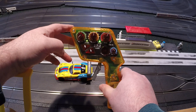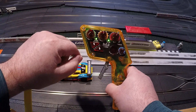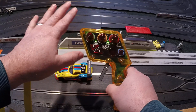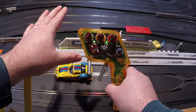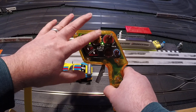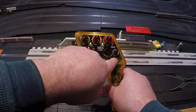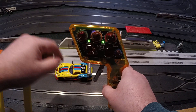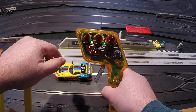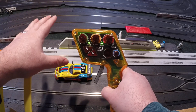You're going to have to experiment with all of these, but rule number one is: only change one knob at a time. Mess around with the min speed knob, don't change anything else, and drive the car around. Once you think you know what it does, set it to what you want, then tweak brakes, then the curve max knob, then the fast/slow switch, then the power trim — just one at a time until you fully understand what each control is doing.